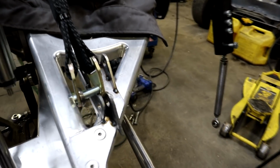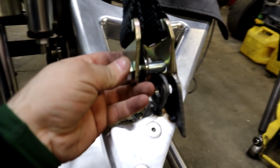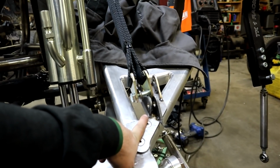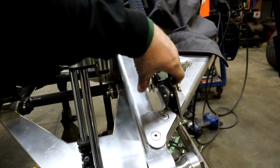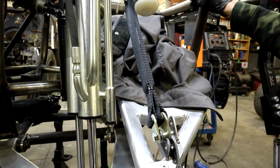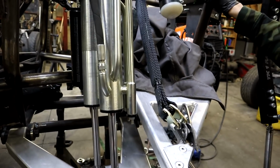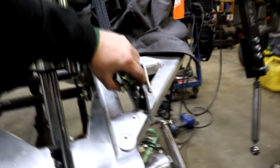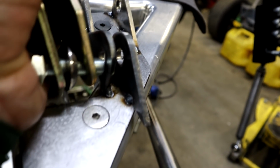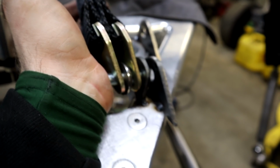So as you see with these limit straps, right now they can't go in. That's because we're fully extended. When we put these in, we measure up to estimate about an inch of stretch. Different limit straps have a different stretch amount, but you got to remember the constant back and forth of the motion going up and down is going to wear on stuff. So we measure an inch short, and you can kind of see here, because of the radius of how this arcs, that's where the bolt hits, and as Joe brings it up, it brings it in to alignment.